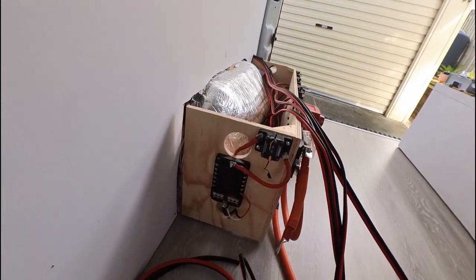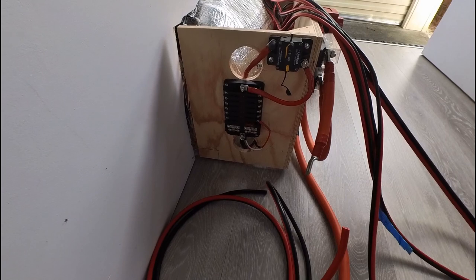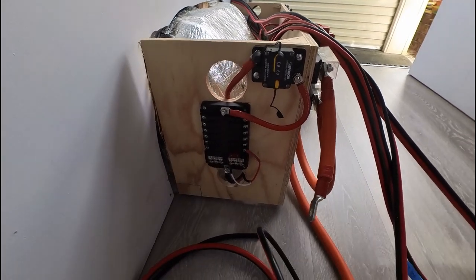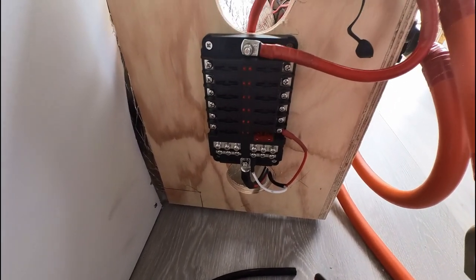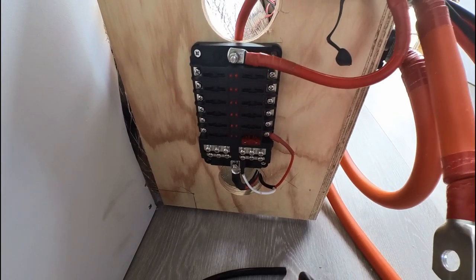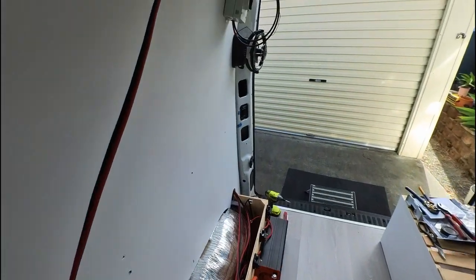We've been working hard today getting the 12 volt fuse panel connected, as I mentioned earlier. And let me show you what we've got. So I've got the fuse panel connected here. It's running through a circuit breaker, and I have one string of appliances connected there with a 10 amp fuse. And so what have I got installed?